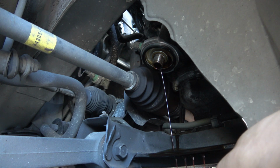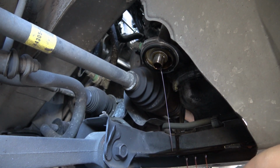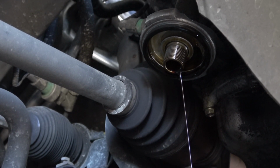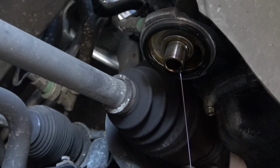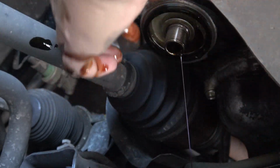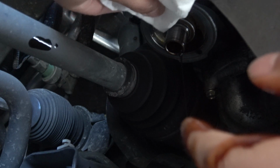And one thing you're going to want to watch out for here, the actual rubber seal, the gasket. If you guys notice, it's still stuck on there. So you want to make sure that before you install the new oil filter, if this occurs, you just pop it off, because you don't want two gaskets, because most likely it'll leak.